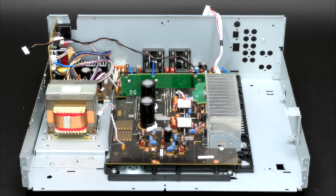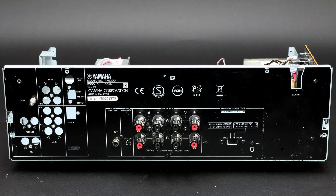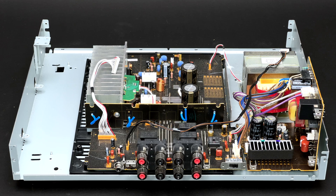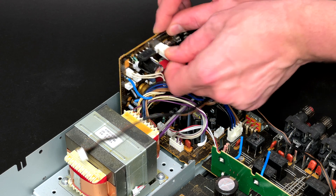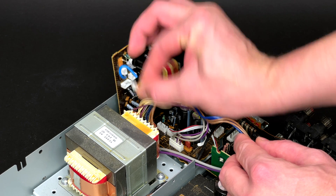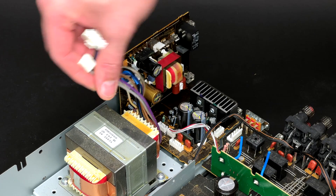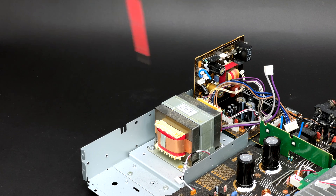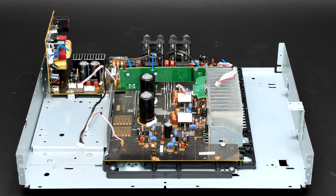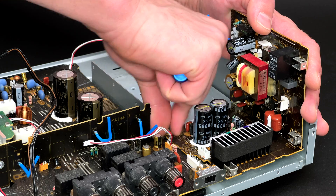That was the last step of the disassembly procedure listed in the service manual, so now I have to figure out what to remove next myself. It would make sense to remove the rear panel next — 11 screws are out and the panel is removed. Next I will extract the transformer. Here goes the main transformer feed and this cable goes to the main PCB. This is a dedicated transformer winding to feed the gadget charger, and here is the feed for the operation PCB which feeds the pre-amplifier section. After undoing 4 screws the transformer is extracted. Then I will remove the two power PCBs — one last cable linking them with the main PCB is unplugged, two screws are undone, and both PCBs are extracted.